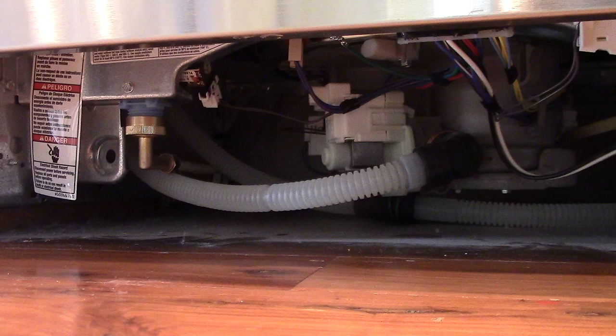Then inside you should be able to see the impeller. If you stick your finger in, you should be able to spin it a little bit. If it's stuck, it might be stuck with a bit of debris or something, and you're going to need to take it off to clear it out. Normally this isn't the problem — usually it's just clogged screens.